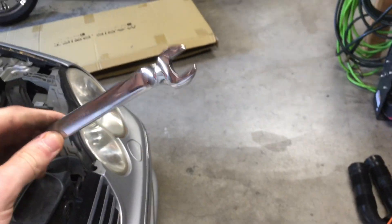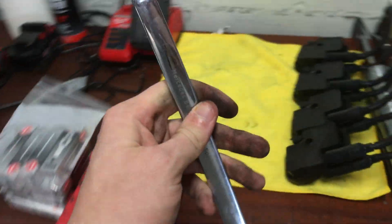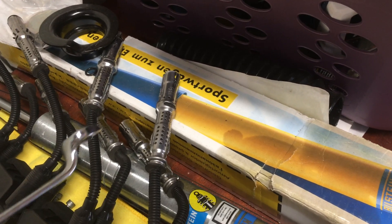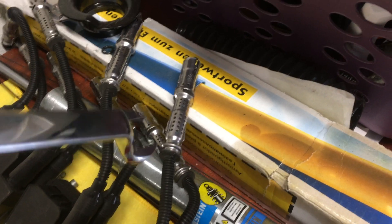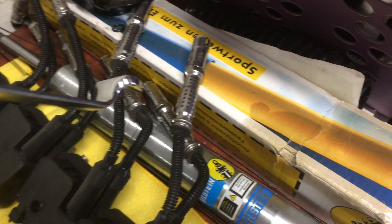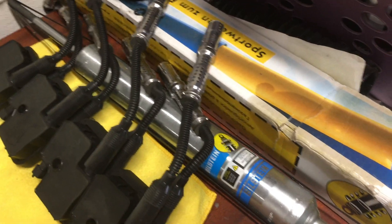I have the Mercedes tool. If you have some type of plug puller wrench there are other ways to make it work, but I got this when I was first starting out. On each one of these plugs - and please make sure you get the metal casing plugs, don't go for the cheap plugs with rubber ones because they'll just tear and shred apart. Even these ones the rubber boot kind of got stuck and is slipping out. When I first got this car and did the spark plugs it had rubber style ends on them and we literally ripped them to shreds.